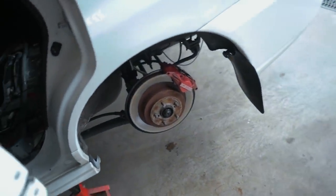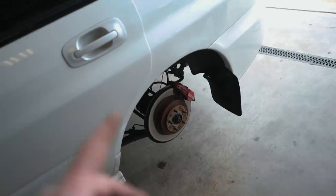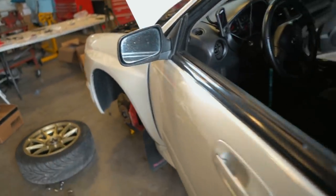Hopefully we don't have to do anything crazy. We got the interior all buttoned up. I'm going to fire this thing up, let that compressor fill that tank all the way up, throw the wheels on the car, get it off the jack stands, air all the bags up, get it on the ground, and then we have to set the air-out height, the ride height, and adjust all the bags. Of course we'll calibrate the system, make sure the wheels don't rub on the fenders, and make sure the inner fenders don't need to get pulled out.